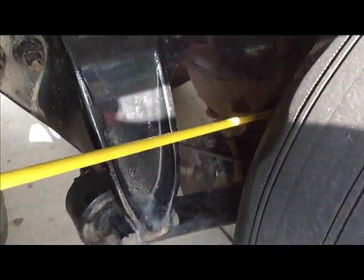Back in here behind the tire, clear back in. I don't know if you can stick that camera up over the tire or not. Clear back in here is, of course, a U-bolt. You have to have the U-bolt. It has to hold it together, okay? Not cracked or broken. No unauthorized welds with the nuts secure on the bottom.